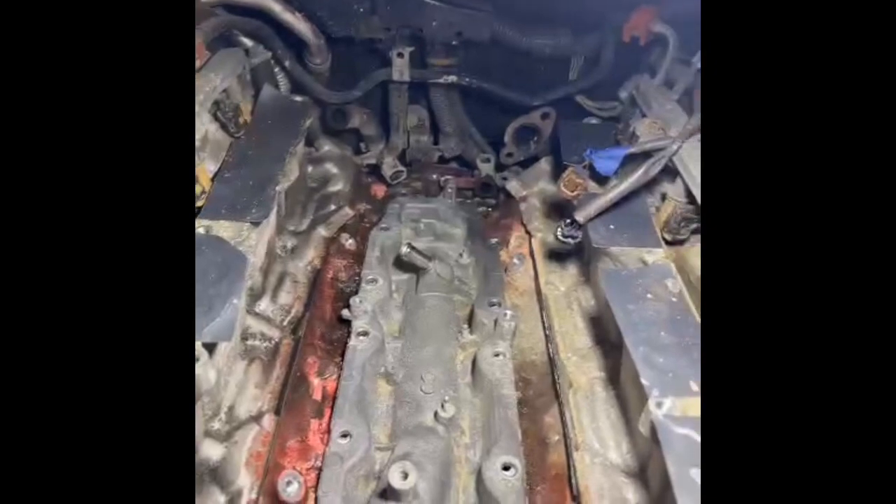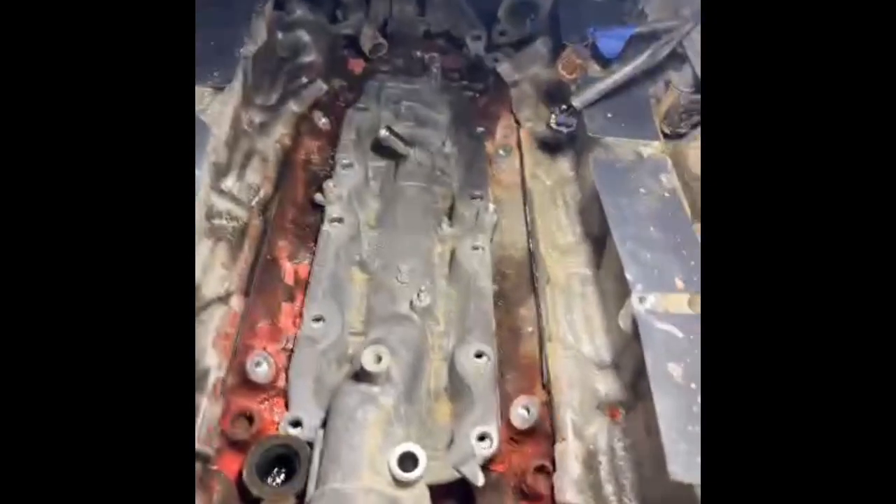What we're doing as part of this project basically amounts to re-caulking a bathtub — only the bathtub is about 80 feet underground, if we want to torture the analogy a little bit. We need to reseal the flange around this cover where it connects with the engine, applying new sealant along the flange. I've scraped off all the old stuff that was defective. It didn't require much scraping because it had lost its adhesion — it was brittle and crumbled. That's why these engines develop the leaks they do.